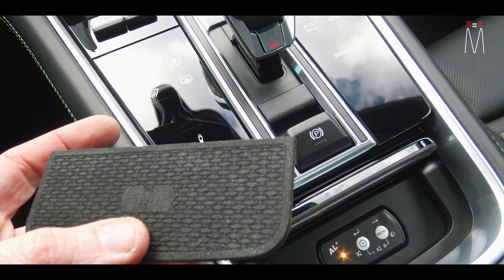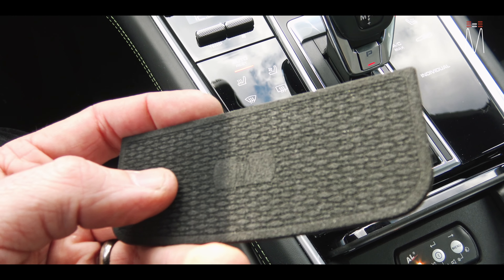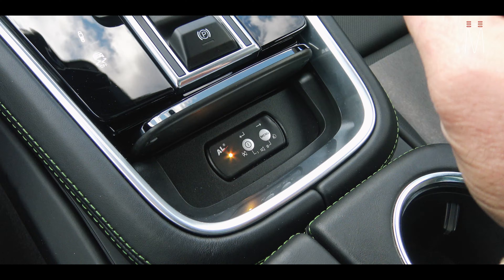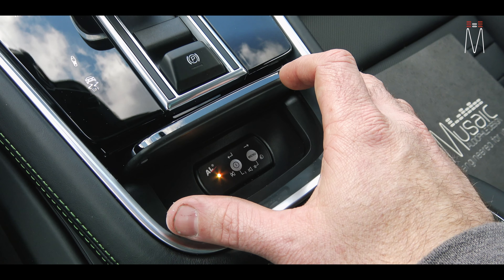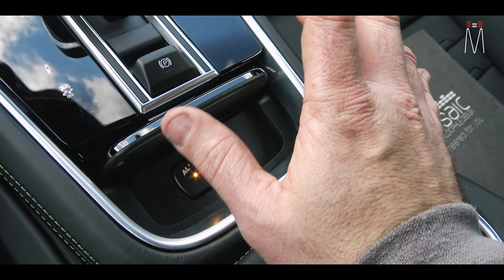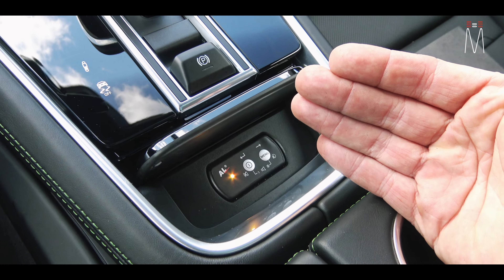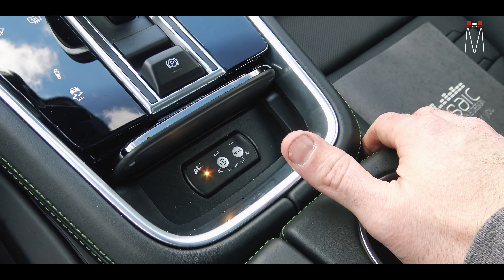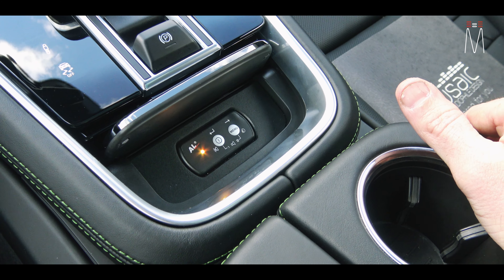It's a durable material to have in this spot. We made that design and rastered it with our laser to create all of those marks you see there on that cover. With this controller we have three different profiles. Profile A is a laser diffuser defense — it's going to block the signal for about five seconds. When you get hit it continues to block and defend for about five seconds, then opens up the signal so the person shooting could get a reading. This gives you the opportunity to slow down without constantly blocking the signal, so the person shooting won't believe you have anything in the car.